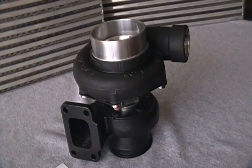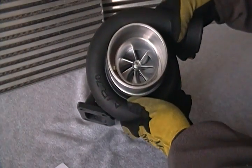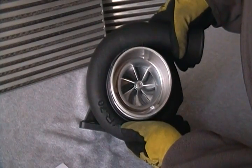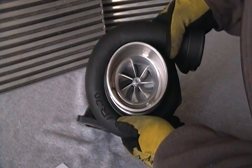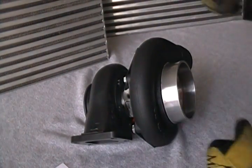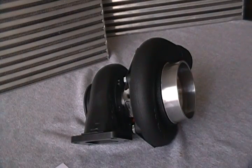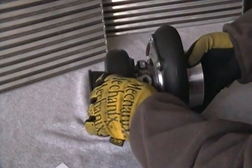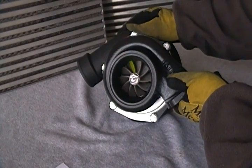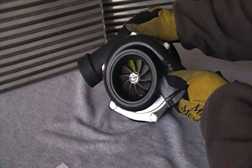Let's look at the composition. Like the journal bearing Reaper, this is a full Garrett product with the exception of the compressor wheel. We're using all Garrett components here because this is based off of the GT35R. We're using T6 7075 forged aluminum for the compressor wheel, and of course the Garrett all-encompassing, all-efficient 68 millimeter turbine wheel — the N111 turbine wheel.